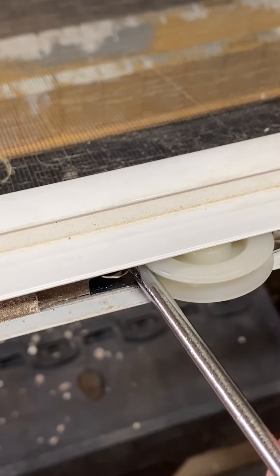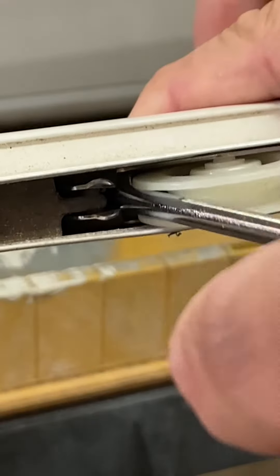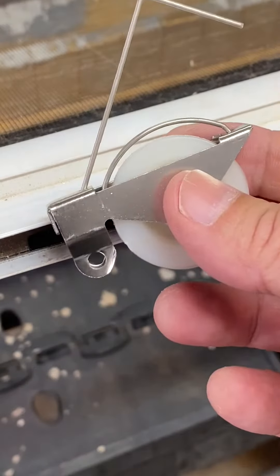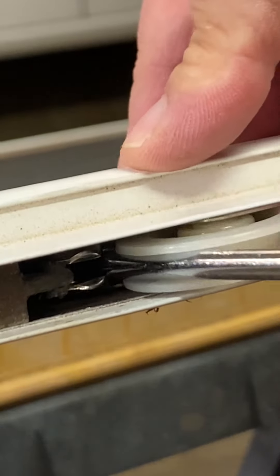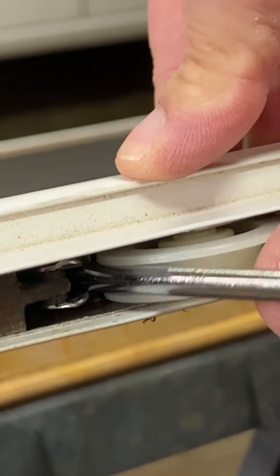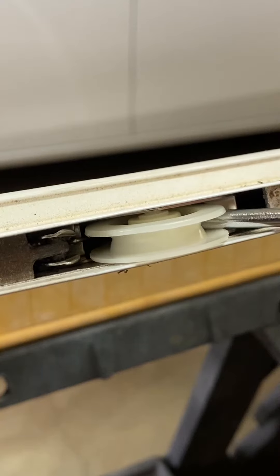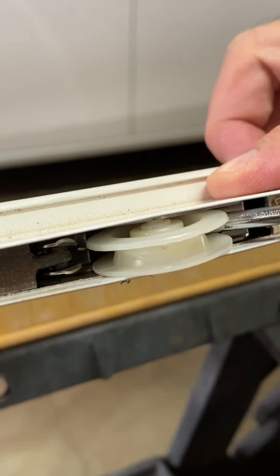I'll practice on this cleaner top roller. To remove, insert and push the screwdriver, then wiggle it side to side to spread open and release the tabs. To install, insert the screwdriver and use an arcing motion to lift and spread the tabs. Remove the screwdriver and insert it from the other side of the roller. Push the roller towards the tabs and wiggle until the tabs engage with the pegs.